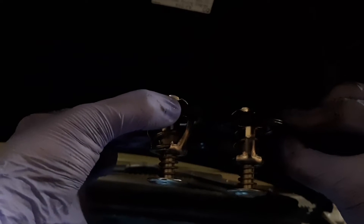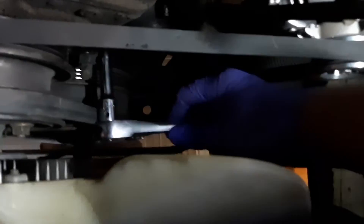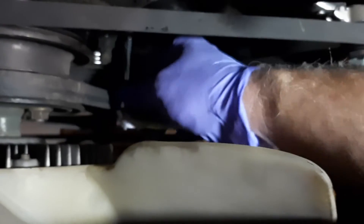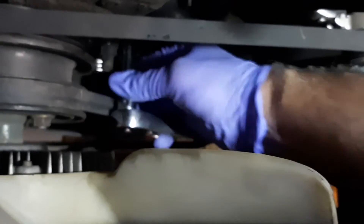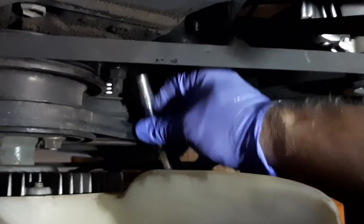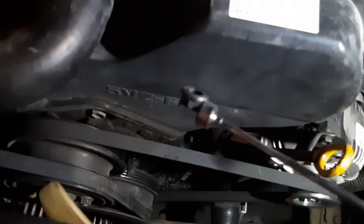So what happened with this repair is the first thermostat I installed yesterday isn't working right. Right away the car started overheating during the warmup process — the gauge moved way beyond normal, so I shut it down. What I suspect happened is the new thermostat didn't open, or it was the wrong size, or some other problem. So coming up I'm going to show you a review online where apparently this happened to someone else. I just decided to pull out the new thermostat and compare it to the old thermostat, because the old one was functioning fine.